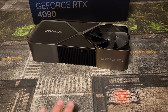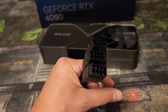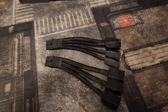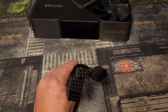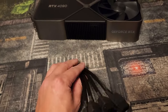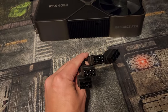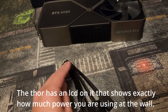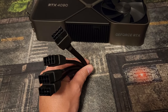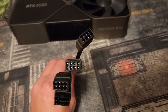So if you have a 4090 Founders or any other 4090 that comes with a 4-plug adapter and you only have an 850-watt power supply, only plug 3 of them in. If you have a 1,000-watt, I personally wouldn't try to overclock with that. But if you have a 1,200-watt power supply or more — especially something like the ASUS Thor — I would definitely consider it. You would plug all four plugs in if you want to go over 100% power draw, and with 1,200 watts or greater, you should be perfectly fine.